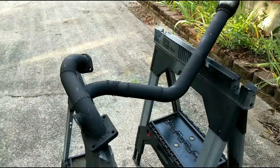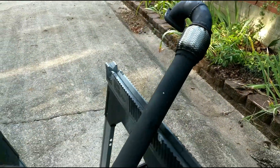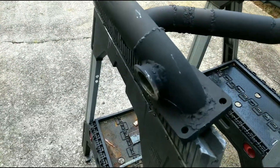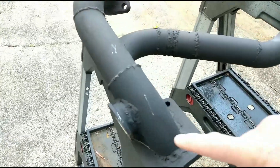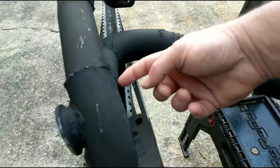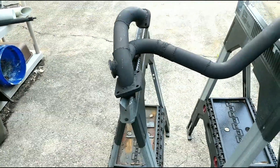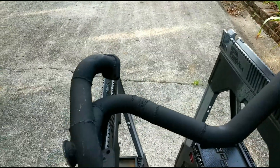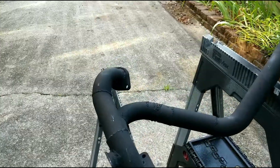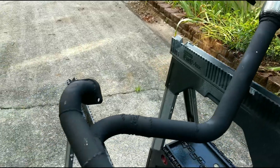Here's the hot side. I did get it painted, and I put in a flex joint right there. I am kind of worried about the placement of my wastegate, but that's really the only spot I had — it'd be much better if it was in line with the flow. But hopefully since it's coming in right here it's kind of on the same plane, so hopefully it'll still control. If not we'll have to figure out something else, might have to stick one over here somewhere. As you can see this definitely ain't the prettiest weld or anything.